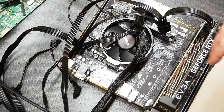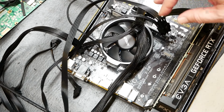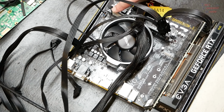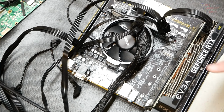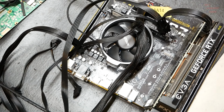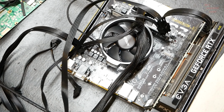I've got his Ryzen 7 5700G into this known good test motherboard of mine. I have my own memory that I know is good for now plugged into there. This is his original video card. I've reset the CMOS on this, which you should always do when you introduce a new processor to a motherboard at any time. This is my usual troubleshooting techniques.